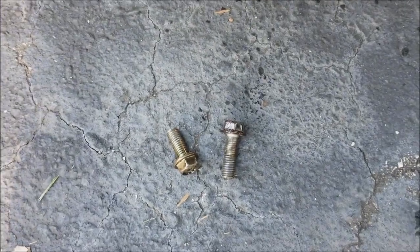Pro tip: when you're removing those two 12 millimeter bolts, remove them at the same time — what I mean by that is loosen one but do not remove it, then loosen the other one. That way you have more resistance when loosening the second one. If you remove one all the way first, it's going to be a little tough because that slave cylinder will want to rotate as you're twisting. I used the flare nut wrench to remove it; if you have a slim fan on your car you can use a regular socket.